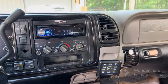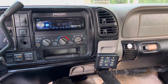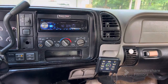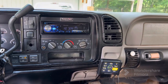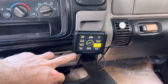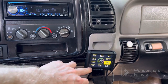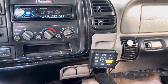Simple video — we're talking about adjusting your idle air control valve on your Gen 3 LS. This is for 4.8, 5.3, and whatever other Gen 3 models. This is cable-driven; not sure if it's the same for electronic throttle bodies. As you can see, our idle air control is around 20%, and it usually runs about 30%. The normal operating range is anywhere from five to ten percent.